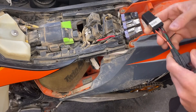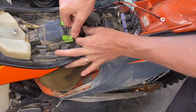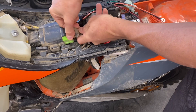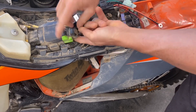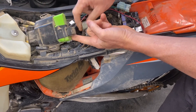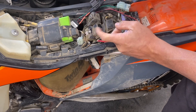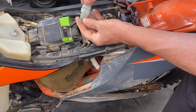Installation is very easy. The first step is to find the diagnostic port. This is the ECU, and there's a little rubber holder here — this is a six-pin connector, the female six-pin. You might do well to just pop the ECU up and pull this thing out. That's the dealer diagnostic port, and this is where we're going to plug our relay into.